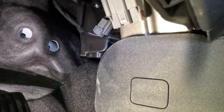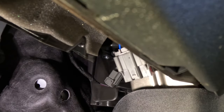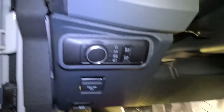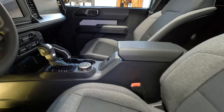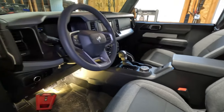Coming into the Bronco, if you come right under this dash, you can see this is the plug that we're going to be looking for — this is what we're going to be plugging everything into. We're probably going to be mounting the module up underneath here somewhere. The real question is where do we want to put the controller knob. We're thinking either here or here. The other option is I've seen people add them right here, but the problem is when you push on the knob it activates your trailer brakes, and the last thing you want is to be towing down the road and accidentally activate that when you're not wanting to.